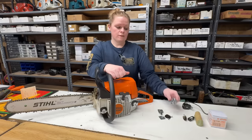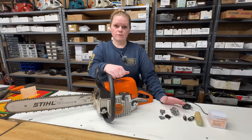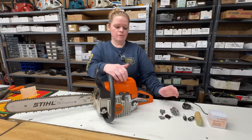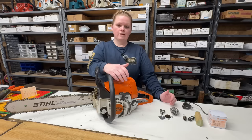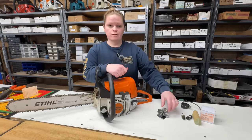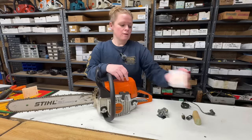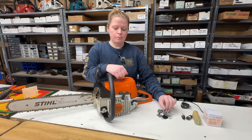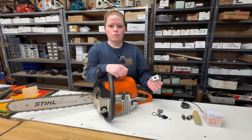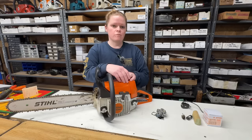I went ahead and removed the carburetor and removed the pump side, and immediately noticed there was stuff missing inside — the fuel screen strainer isn't in here. Once I open a carb up and I see that someone's been into it trying to rebuild or clean it, and there are parts missing and the jets are turned out, that's a big red flag. So I am not going to rebuild this carburetor — he's getting a new carburetor. They're not that expensive, I think it's $60 or $65. Once I've opened a carb and see somebody's been into it, parts are missing and jets are all turned out, I don't know what's happened to it or what the original problem was, so I'm not going to spend any more time on it.